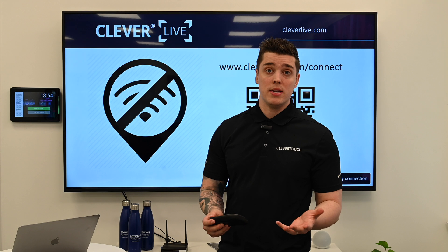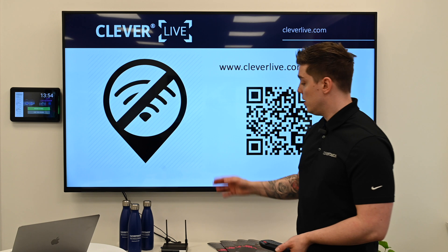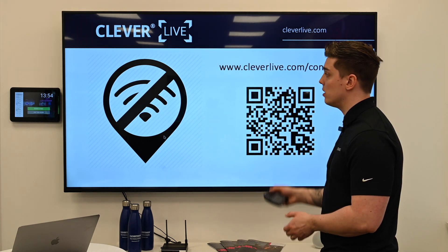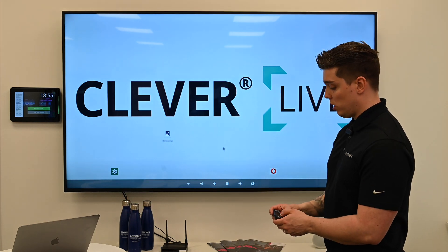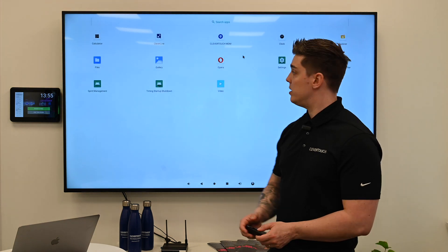The first step is you'll probably see this — it basically means we've got no network connection. Now, if you've plugged in an ethernet, you can skip this step entirely, but I'm going to utilize Wi-Fi. So what I'm going to do is right click — that'll send me to this page. My settings cog is on the home screen. If for whatever reason yours isn't, you can click with the mouse and drag up from the bottom, which will bring us into the Android settings menu.